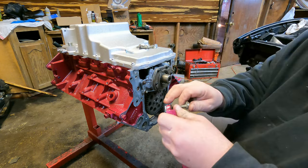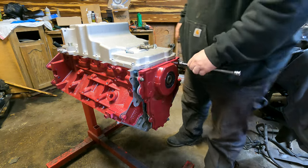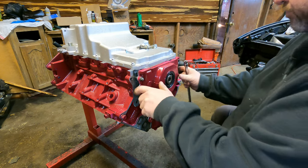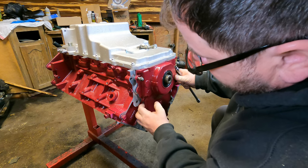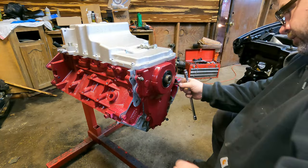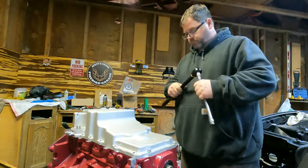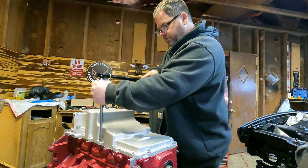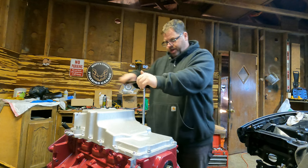We're just referencing this gasket again with some bolts. Hey, the right size. Push that in there like so. When we have these witness marks on the block as far as where it lines up, we want 18 foot-pounds on the oil pan bolts. We'll go from center out.